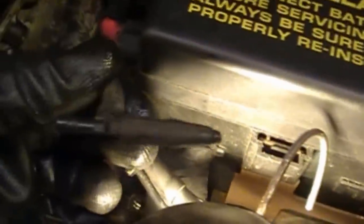The valve covers are straightforward - you just unbolt them and pop them off. Before I did that, I took 15-20 minutes to pull the wiring harness off to the side. I unhooked everything from the O2 sensor, the battery, and some stuff down there, and just pushed it off to the side to make it a little easier to work on. There are a lot of little hoses to watch. I already broke my little air line, so just make some notes and take a few pictures and you'll be okay.